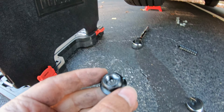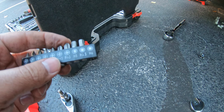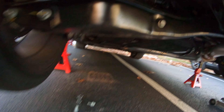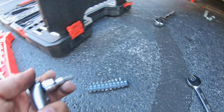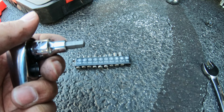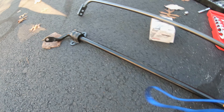There's this bolt which is a 17 millimeter, so you need an open end wrench and an H6 hex wrench tip. I had to hold the inside of that bolt because it kept rotating. If you can hold it, you can usually stick it in between the suspension. Once you take off the bushings, you can move it around and stick the hex in to hold it, and the bolt will come right off. The bolt on the other side came right off too. Here's the difference between the two sway bars.